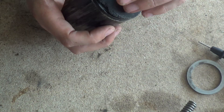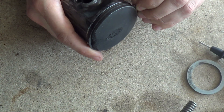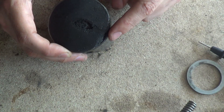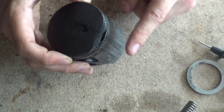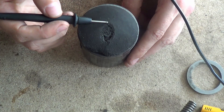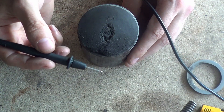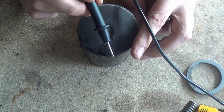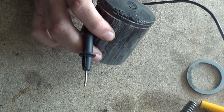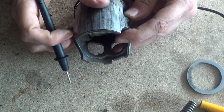That's an excellent example of detonation and pre-ignition on a two-stroke, and why measuring your squish band and keeping an eye on how your engine sounds is seriously important. You can see when I put the ring back on — it's basically just blatting away and eroding all this aluminium in the direction of the exhaust port. There's a clear flow path: the spark plug sits right here, and all the swirl and turbulence heads towards the exhaust port where these hot gases are burning and just chewing the hell out of it. The thing got way too hot and then heat seized on him.